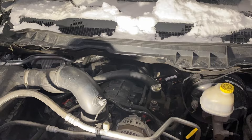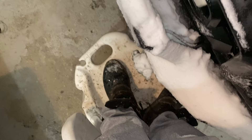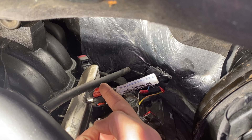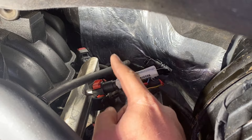It is in an awkward spot, so I've got myself a stool here. To remove the old fuel pressure sensor, just grab your flathead screwdriver or your pick and pry over here. This tab comes up. Once that tab comes up, you can squeeze both sides together and pry it downwards. Once this clip comes down, you're no longer locked on the nipple and you can pull this off.